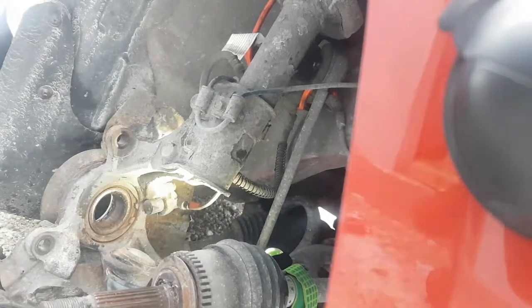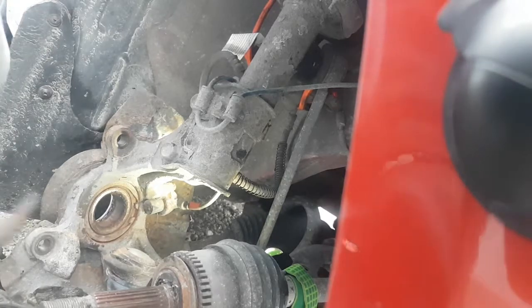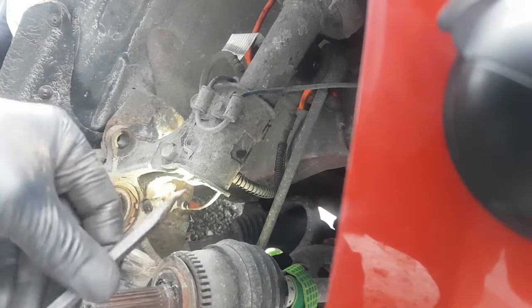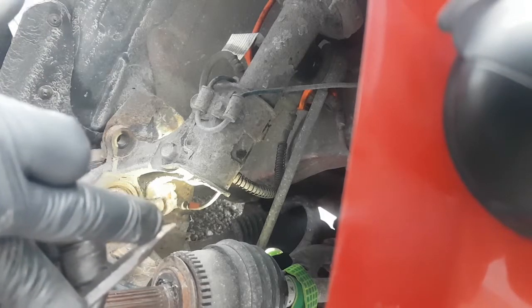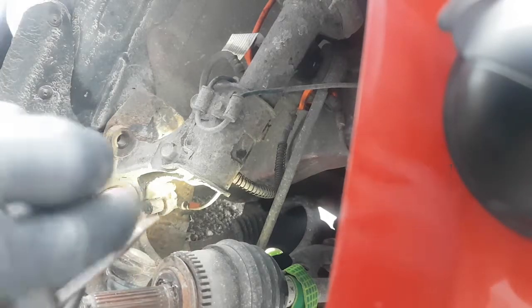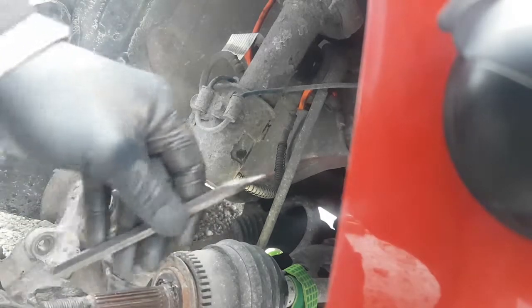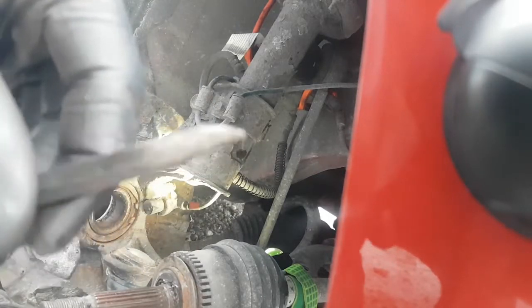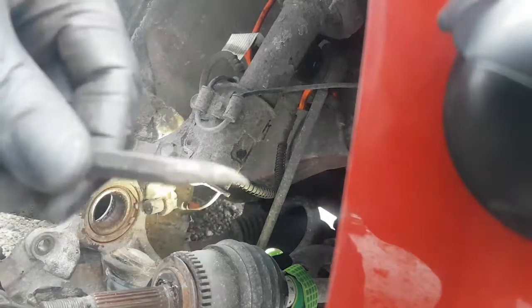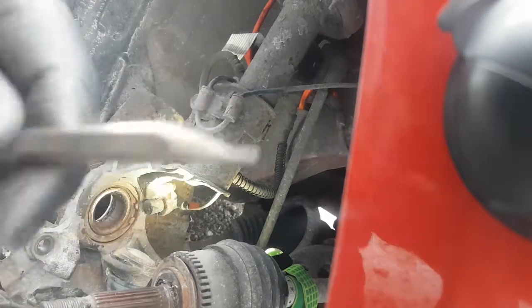Okay, let's get a small chisel. And I still have that special chisel here. Do you guys want to see the special chisel to get these things out if you break the ends off? That's the special chisel I had to make. I've cut a special little groove in here so that when you get it under the ring, it'll lift the ring up and out at just the right angle that you can twist it out of there without it binding. It took me quite a while to make this thing, grinding and trying, but I got it done. As you can see how much I had to grind off on a bench grinder. Took quite a bit of time, but we'll give it a shot and it should work for us here.